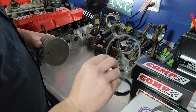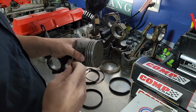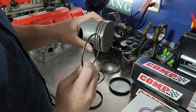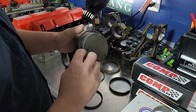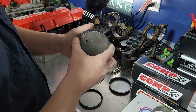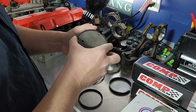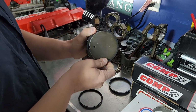So we're going to put our primary or secondary compression ring. That's going to be the bigger one that sits in this channel. You can also just test fit. In my case, it doesn't fit in the top one. It can only go in the bottom. And the dot's going to go up. So make sure, like I said, these are the ones you have to be careful with. So take one end, press it into it, and just start working it around.